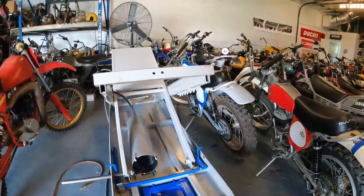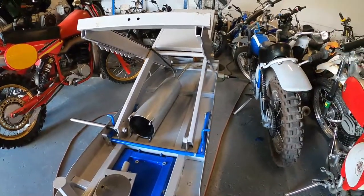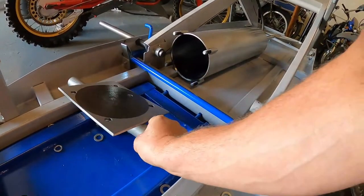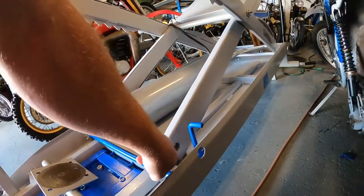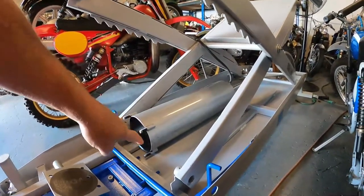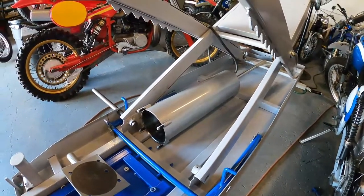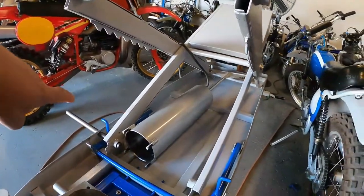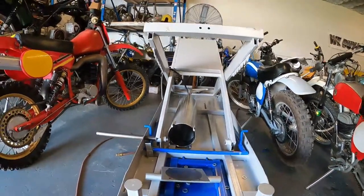To get that out, you have to flip it on its back, prop it up, and hammer the pivot pin out through the plate. There are supposed to be retaining wire clips — they look like wrist pin clips — but they were missing. And here I had a busted grease fitting from the factory, so I have to re-thread that and add a grease fitting there. I banged that through and then you can look in the cylinder — it's clean. That wasn't the problem.